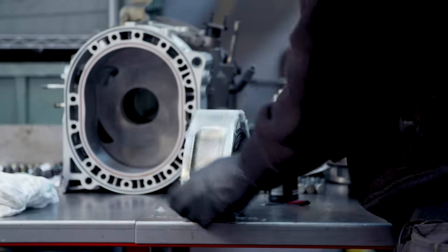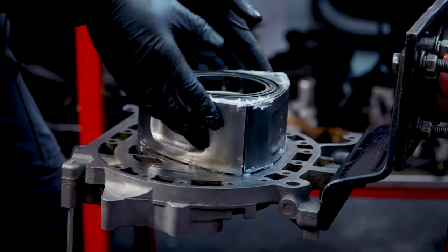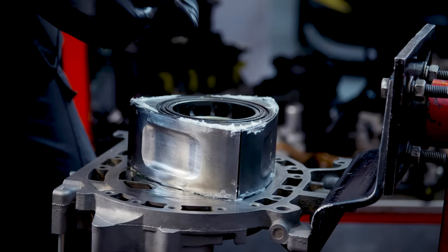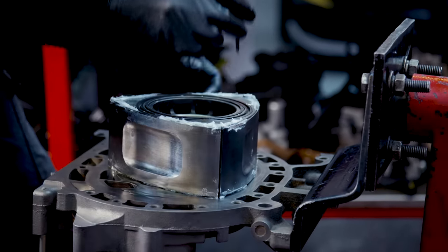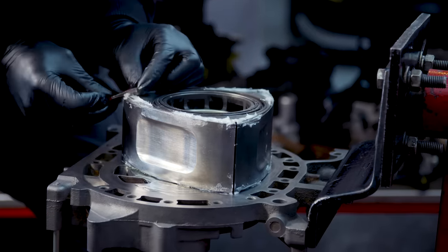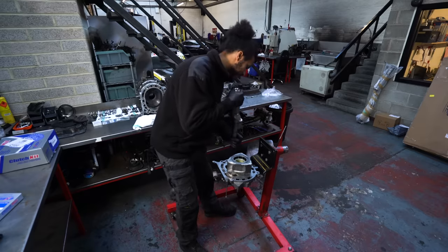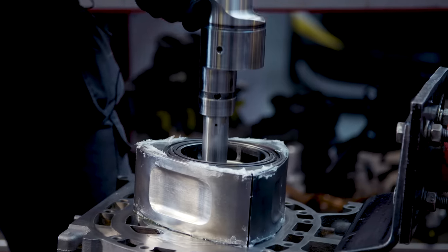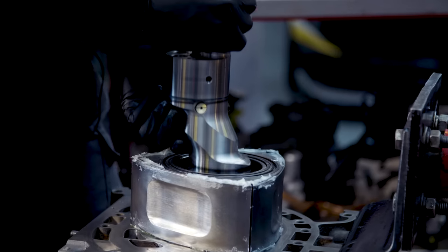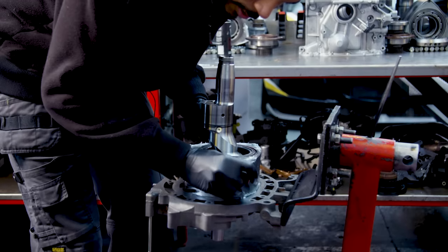You don't want to risk it, otherwise the rotor will have to come out again — and because it's all caked in Vaseline, it'll all stick to the front iron and you'll have to reassemble it all. There's no right or wrong as to how to lay it, just as long as the gears meet. I tend to have it pointed horizontally and then tweak it just a little bit. Once again, make sure the corner seals are aligned just so the apex seal slides right in. Next comes the E-shaft — bearings are already lubricated, so it should just go straight in with no resistance.